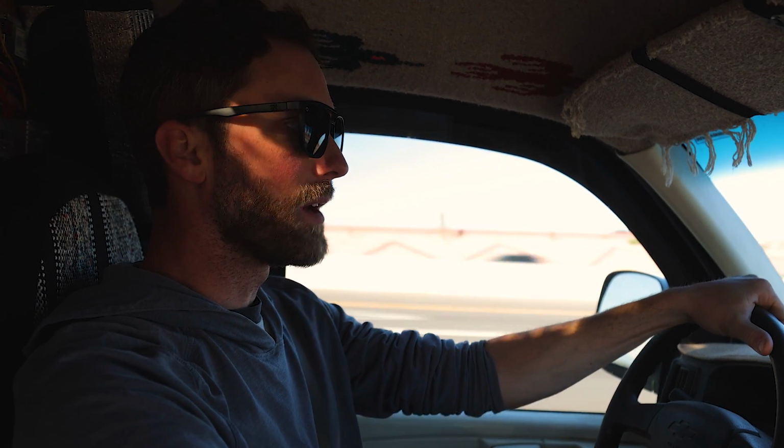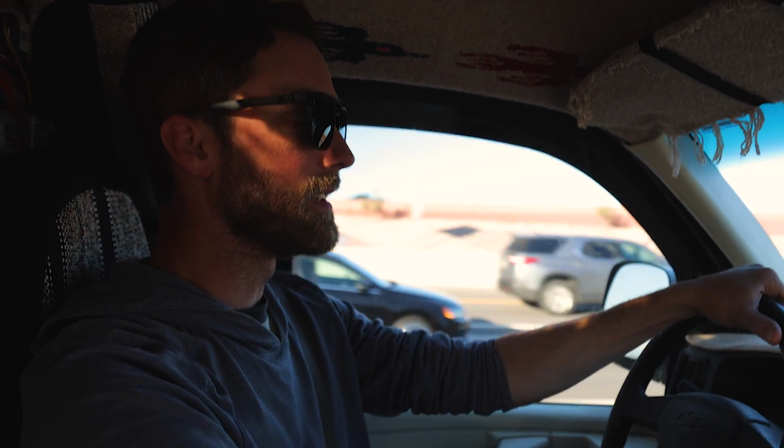Well, we're back at our favorite city in America, Phoenix, Arizona. We're back here because the gear whine has evolved to a whine on acceleration and deceleration, and we now have driveline vibration. So something in the rear diff is deteriorating. While we're waiting for the gears to be shipped, we're going to take care of the last couple things on Betty. We're going to install the last of the bolts in the rear springs, and hopefully we get rid of the clunk, and we're also going to replace lower ball joints. One day we'll get out of Phoenix.